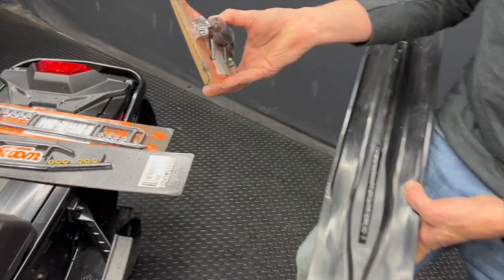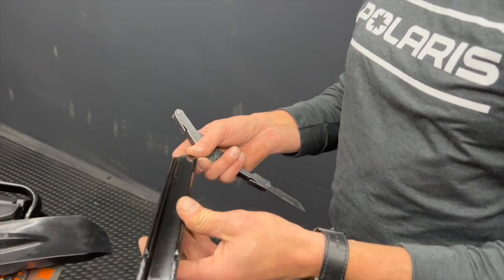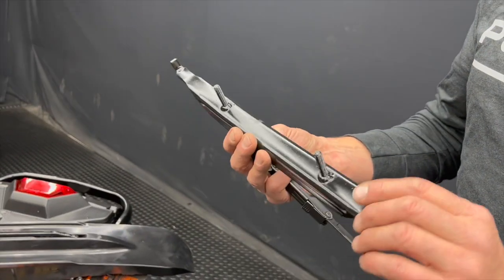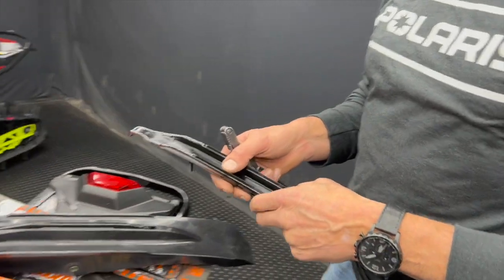The Dually is a little fatter with wider pieces on it, but it's also heavier. The Slim Jim makes the piece a bit lighter and it is narrower, so as it goes down the trail it slices through it. This is what it looks like out of the package — a nice narrow groove, like two rudders. This has six inches of carbide; you can get it with six or eight inch. As it's going down the trail like a tunnel it's making its own groove, so you're not going to dart.